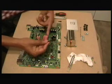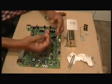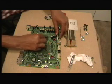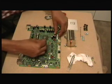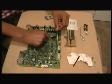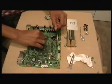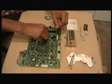You can use anything — a credit card or a quarter — to rub the thermal paste over the GPU chip. This is basically used to help keep the chip cool. Put a little bit more on there, make sure you have enough covering the surface. You don't have to put a lot, just enough to cover the surface and around the edges.